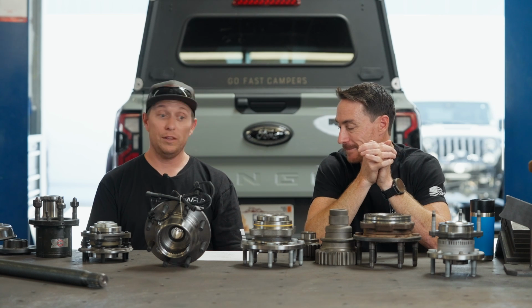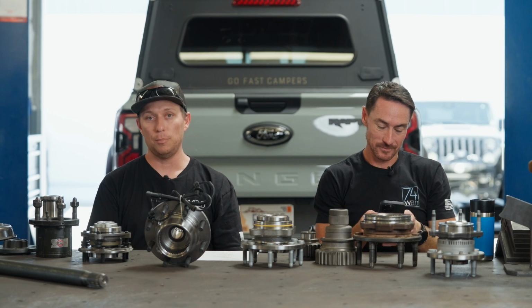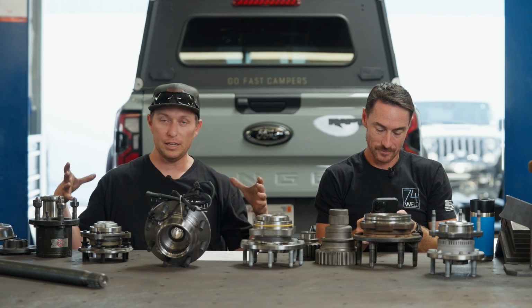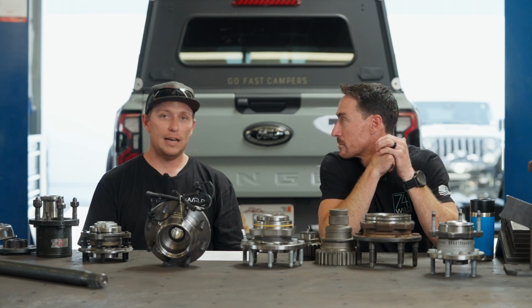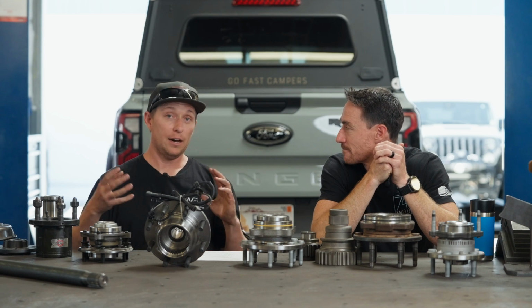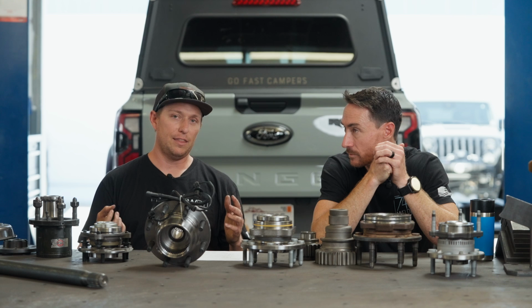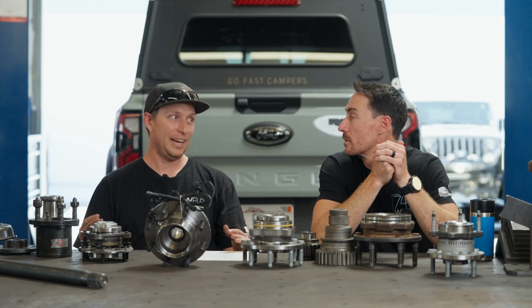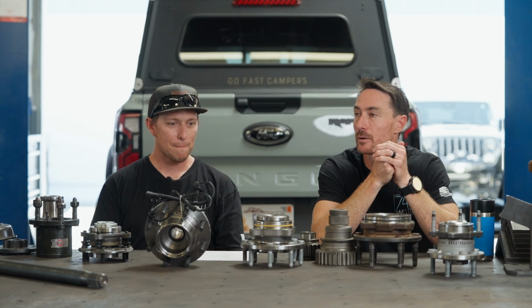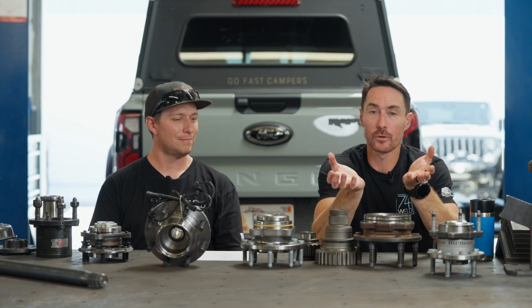So with that, setting tapered rollers, Hummers have tapered rollers. In a portal where you have basically a gearbox that's clamped together, how do you set that preload for the bearings? You either need a cutout with some kind of spindle nut or some way to set that, or the other way is to shim it, which is even more of a pain in the ass. Shimming's just not really a viable option. I did that for several years.